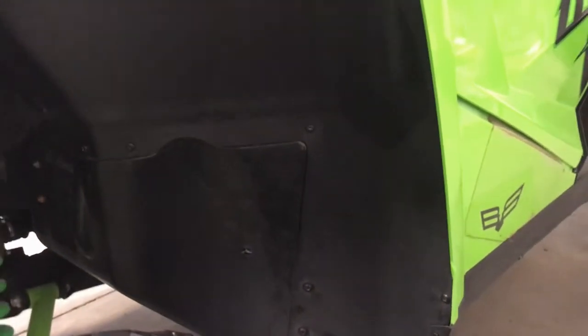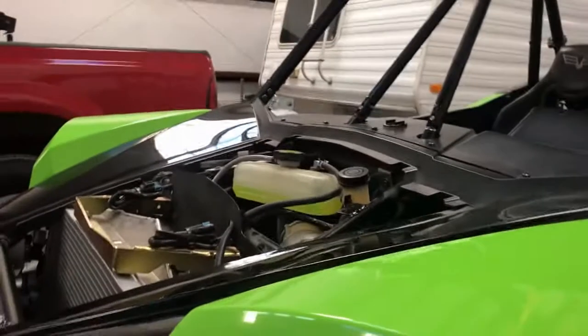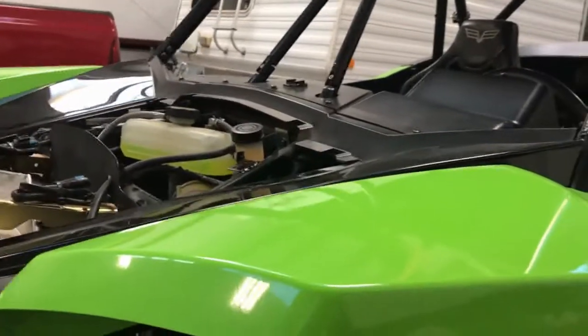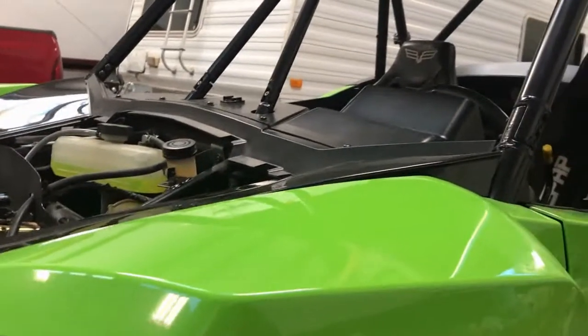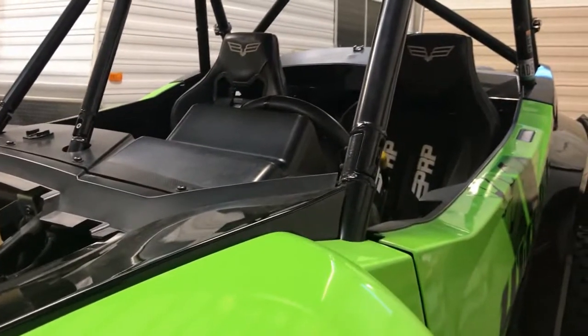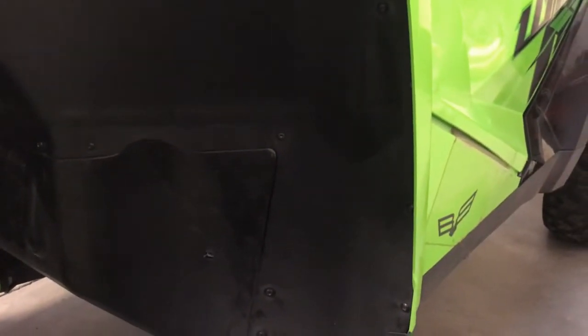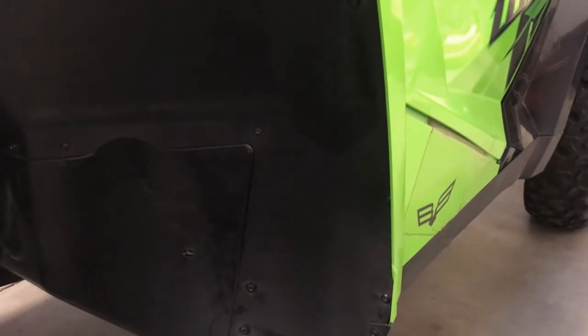Now for the big light bars, anything over 180 watts, remember volts times amps is watts, so if you get above 180 watts, that's 15 amps. You're going to need to run a wire either to your power outlet over here that's always on for the relay, and then use this as a pilot power, or you're going to have to run wires back underneath the tunnel to the battery and use that to power the relay, with C1 being the switch for that relay.